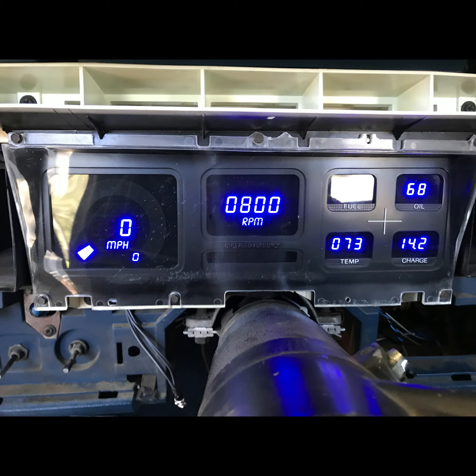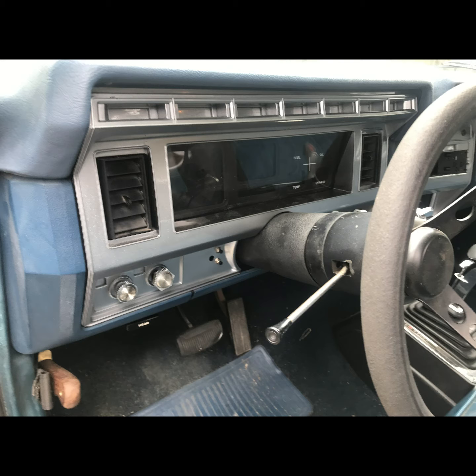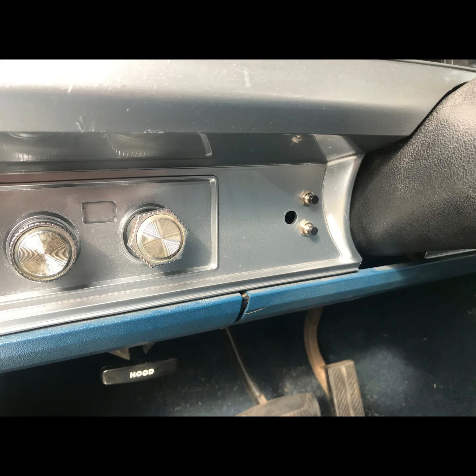From here on in, it's just wiring in reverse. Follow the instructions and attach all your wires with good butt connectors. Put your dashboard back together and mount it back in the truck — it's really simple. There's one more thing: you need to drill two holes to mount the two buttons used to run the dashboard. One is your odometer button and the other is your programming button — I put them right here by the steering column. For example, you hold the programming button and it will cycle through calibration mode, zero to 60, or quarter mile. To calibrate the speedometer, cycle through until you see calibration, touch the button, start driving, drive exactly one mile, push the button again, and your speedometer is calibrated.